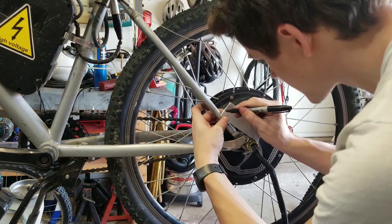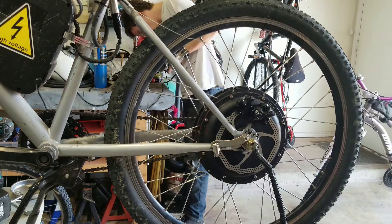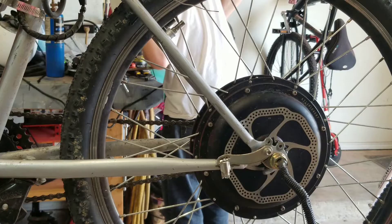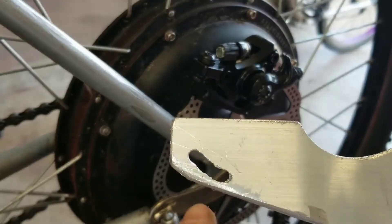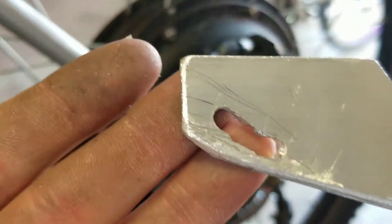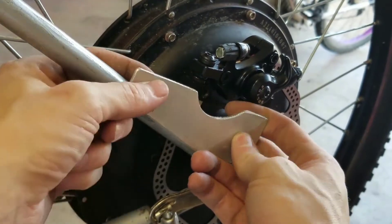The reason why mounting brakes on this bike is such a big deal is that there isn't any mounting point for a rear brake caliper. So I'm using a piece of aluminum to make a bracket for that. I drilled a bunch of holes in it and then drilled the holes bigger until they all met up, so that'll be for putting a hose clamp through to clamp this on.